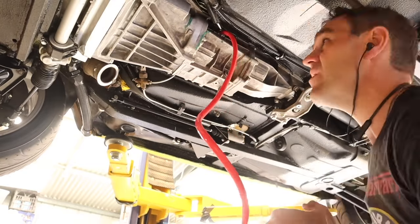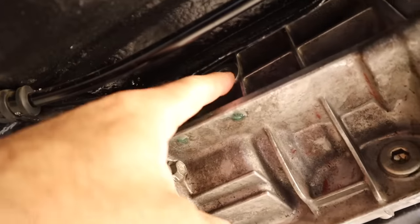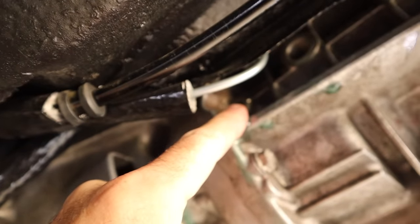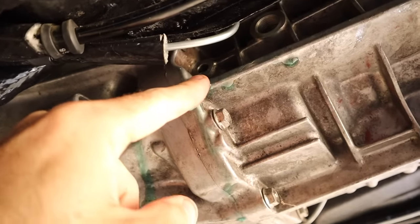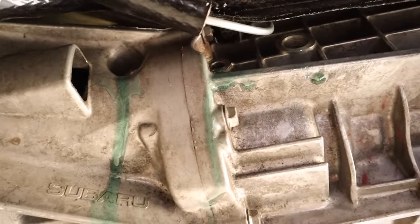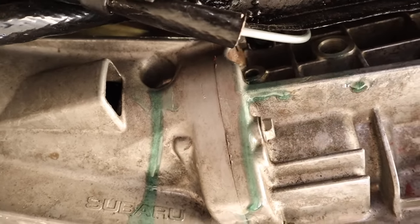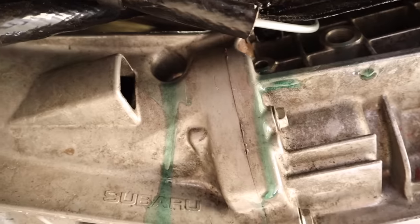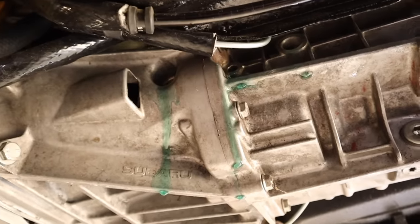I also need to find myself another oil transfer pump for the gearbox because this is the second type I've used and they're both horrible - any suggestions welcome. I started filling up through the fill plug in the gearbox and the oil started coming out - it's basically full - but it's leaking out of two holes on the gearbox I never noticed before. This gearbox was cheap and secondhand off Gumtree, so it looks like it's missing a couple of bolts. I'll put some bolts with new crush washers on there, but I don't imagine there's a good reason why those bolts should be missing.